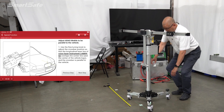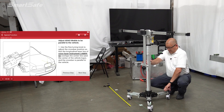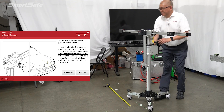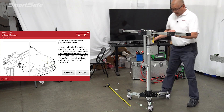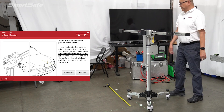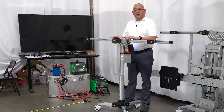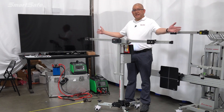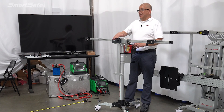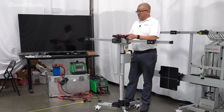Right now it's showing a little bit low on this side, so I'm going to go ahead and crank this up. Okay, looks like we're level there. We'll go ahead and center it again and lock down our casters. Now that we have our target frame positioned at the 6,000 millimeter length and leveled, our next adjustment is to make sure that we're parallel with the vehicle — that would be the yaw adjustment. There's a fine-tuning knob located at the back of the frame, and I'm using the cross laser to check the center point of the vehicle. It looks like we're good right about there, so I'll move on to the next step.